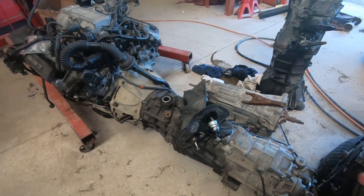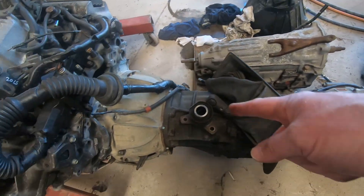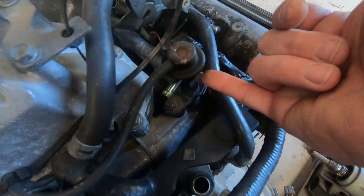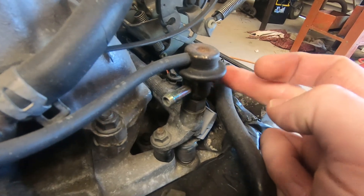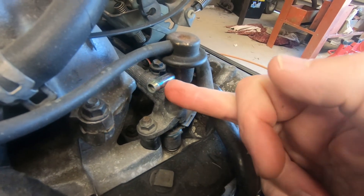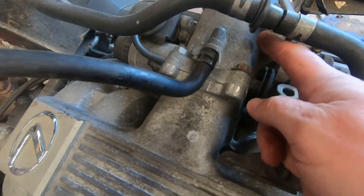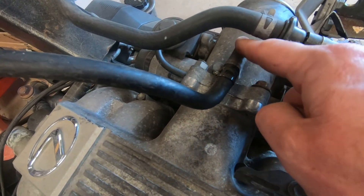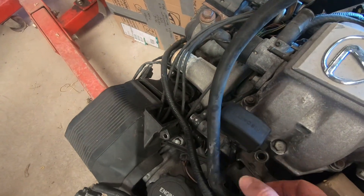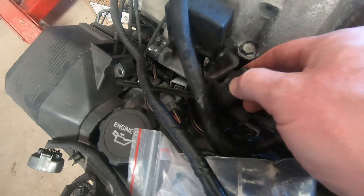I scored this setup — a 4x4 trans with an adapter plate. It's a Gen 2 engine, so it's perfect for looking at the fuel pressure regulator. This is the Gen 2 regulator; it's located on the back of the cast fuel rails with a push-on fitting. Also note the throttle body here — there are different versions of this throttle body. This main port runs through into vacuum in the throttle body, and normally runs around to the VSV — the vacuum switching valve — for the purge system or the breather for the fuel tank.